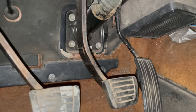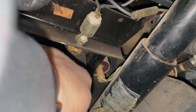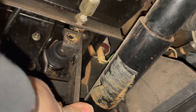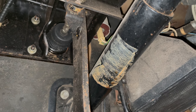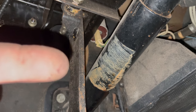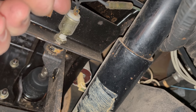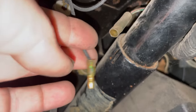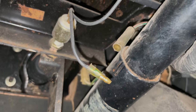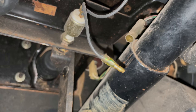I am in the driver's foot well right now. If you go up the brake pedal, there is the switch for the brake light. It looks like that switch is just completely disintegrated — part of it fell apart once I pushed the brake pedal in, and that is why it's not being pushed back to cut the circuit and turn the brake lights off. So I've disconnected the connector that was just behind the brake switch, and now the brake lights won't be on. I'll leave it this way until I can get a new switch.